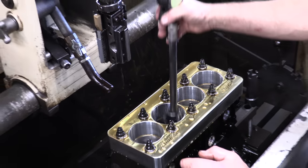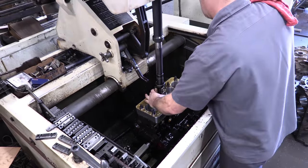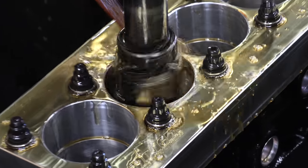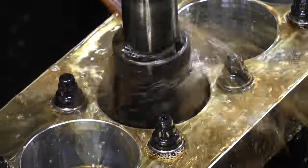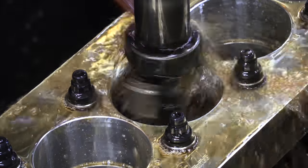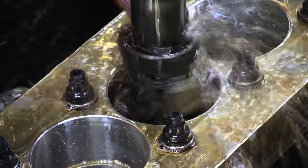So there you have the process. I figured that I'd shut up and just let you see it once through in real time, two things that I never seem to do. It's pretty simple. Calibrate, measure, cut, measure. Rinse, repeat until you sneak up on all of your targets. This machine makes your target bore diameters nice and easy to sneak up on because you're doing it one hole at a time. This example will demonstrate a lesson that will mean more later in this video or as you get older in life. I promise.